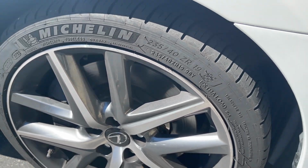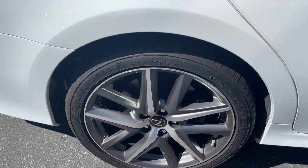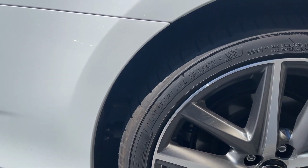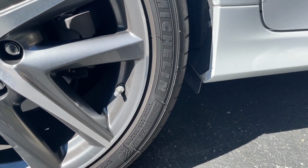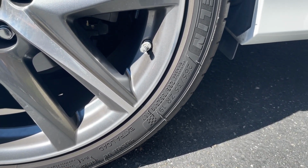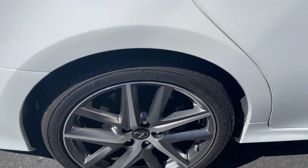But you need to find staggered wheels. It makes finding tires with the same brand a little bit harder. Okay. So you can get better performance and handling. And staggered wheels means the front and the back are different sizes, so you can't rotate them. So I have 265/35 ZR19s in the back over here. So you can't rotate them.